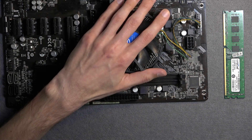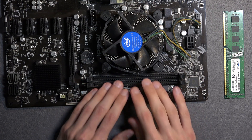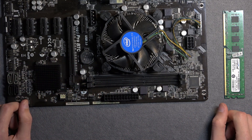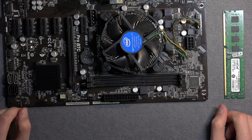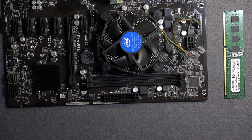If you have a motherboard like this one that only has two slots, this concern is completely non-existent. You'll obviously put RAM into both of them, or just one — and if you're using only one it will be running in single channel anyway.